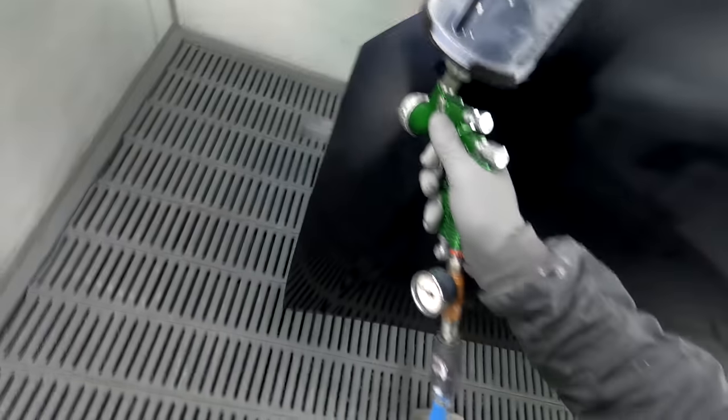I want to get that first coat on nice and wet. And now that it's warming up here in Perth, I'll go bottom to top, top to bottom. I've got the Pro Light Gunman Edition TE10 as the air cap. I reckon this is probably the best air cap to spray this standard blue with. I've used loads of different spray guns to spray the standard blue, but I found the TE10 1.3 is probably the best, in my opinion anyway.